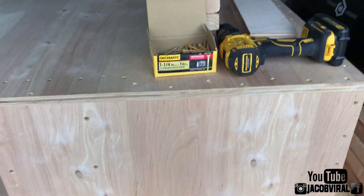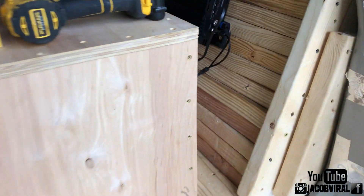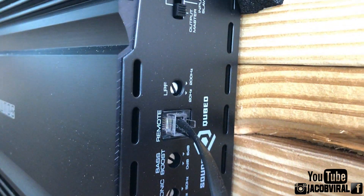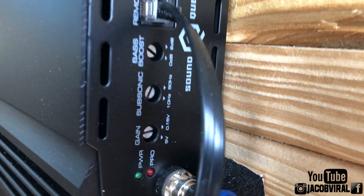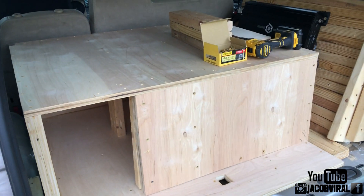I'm going to keep this right where it is, and this is going to be on low volume. Make sure I don't change my subsonic — check out those other videos I mentioned for subsonic settings. I'll keep my subsonic a lot lower with the fourth order than it was with the ported enclosure. About 22 to 24 hertz range — that looks about right. Just don't change it between tuning tests.